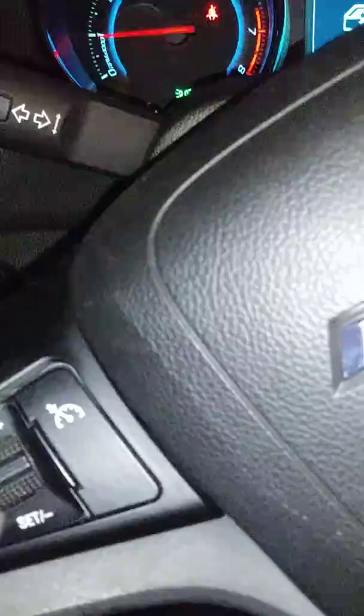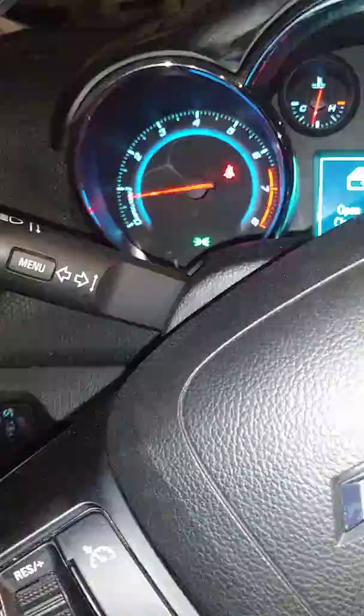Because that's not the turbo. And how do I know that it's not the turbo? It's dumping. You hear that turbo. You know. Come back down. You see that? The car is back to regular, no check engine light. Now you remember when I turned it off and turned it back on, it was acting funny. So that lets me know that there's a vacuum leak, something that is being missed.